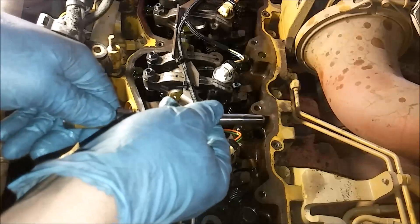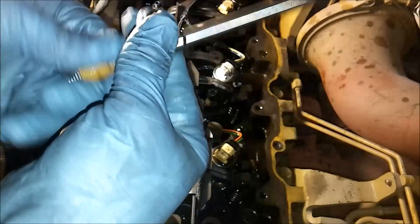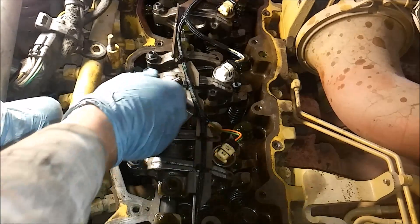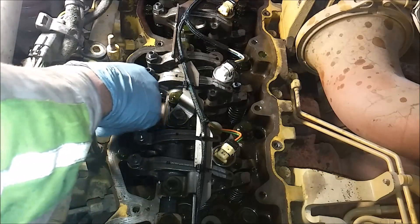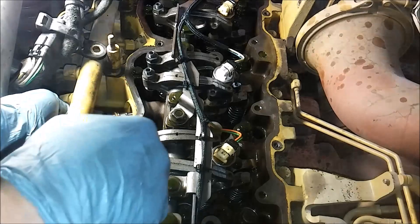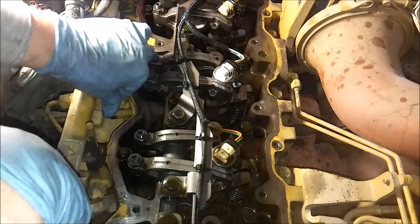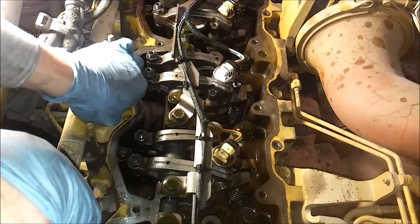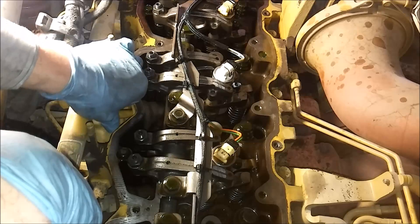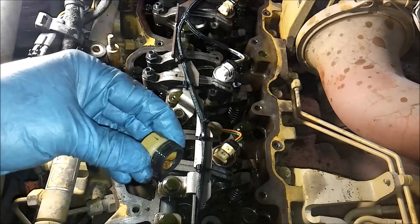And now your quill tube. I've washed this in the solvent tank, inspected it, and put a new seal on there. I'm going to lightly coat the quill tube seal, check the face to make sure it's not damaged, and then you're going to be careful when installing it - you don't want any dirt on that sealing face. Remember that alignment tang on the quill tube? You're going to install the quill tube into the head and then rotate it until it pops into place. It'll go in lightly, then rotate it and you'll see it pop in. Make sure it doesn't come back out.